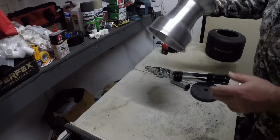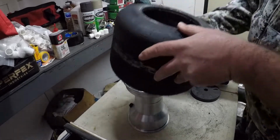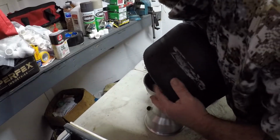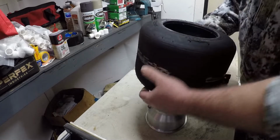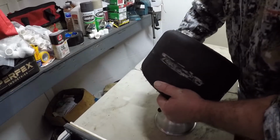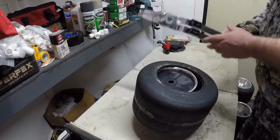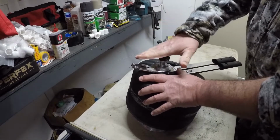Alright. Left rear, thin lip up, valve stem away from me, date code up. That there's wanting to be a little bare. Some of them are. Just gotta get it started. After you do a few of them, you'll get the hang of it.